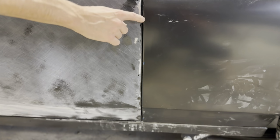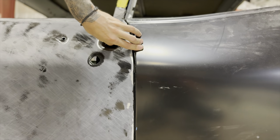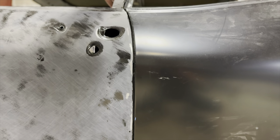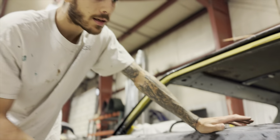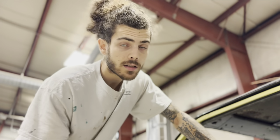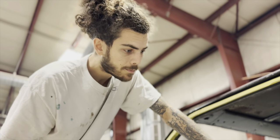So what we're gonna do is splice that open, and then when he does open it to pull it out, he'll also push it a little bit more that way to make this gap a little more consistent. But that's still a little too close. If you look at the other side, it's a lot wider, but the quarter panels are just a little bit different. So that's aftermarket, what you get. So this is almost about a week of Jesse fitting them to get them this close, and this is a lot less cutting than the other people that I've seen, but we'll get it.